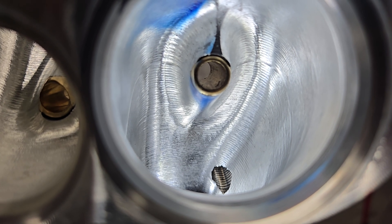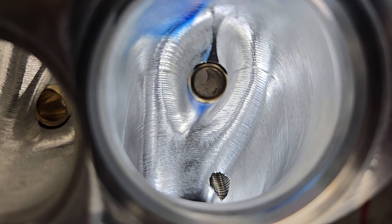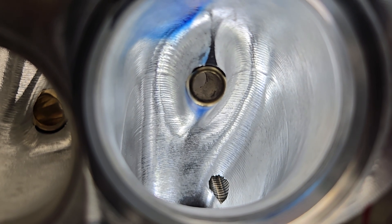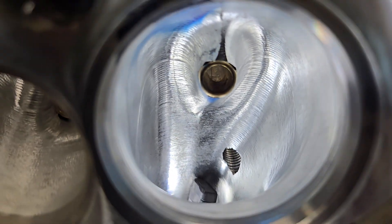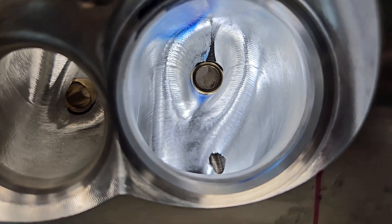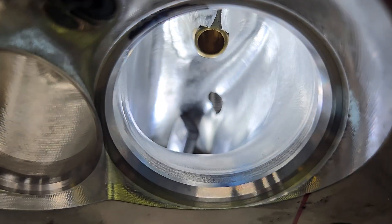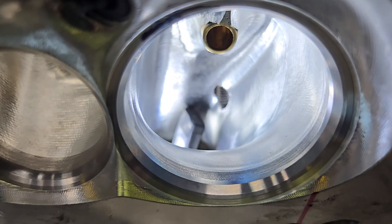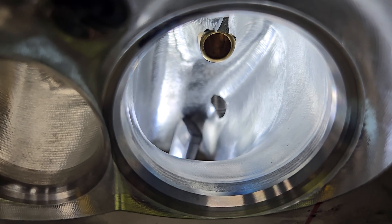You can see where the cutter goes in from one direction and stops and turns around — there's always a little bit of a lip right there, no big deal. I would go over it; of course I'd burr the whole thing, but that's me depending on the application. The short side is done up really nicely. In fact the air speeds across are pretty good. Could they be improved? Probably a little bit, yeah.